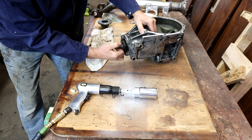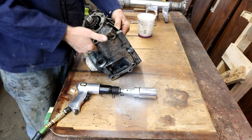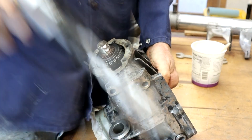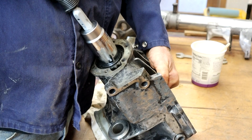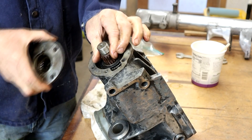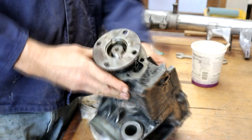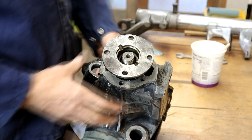I've got a large enough socket that it's not going to rub against the splines. There's the bearing and as you can see there's no way we're going to get the flange on and use the nut to pull it on — so brace yourself. That's got it on enough. We'll mark up where the original flange went, get that on there, and look — we've got plenty of room for the nut to pull on without any risk of damaging the end threads. That was a big success!